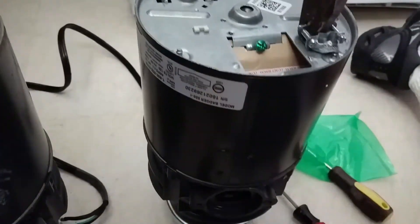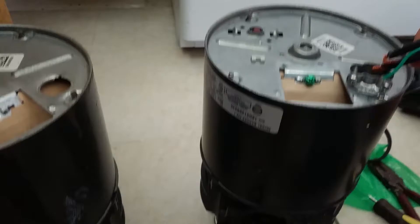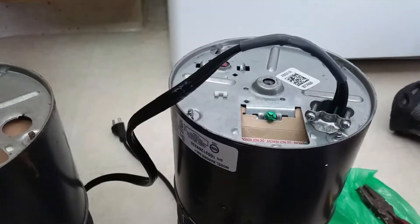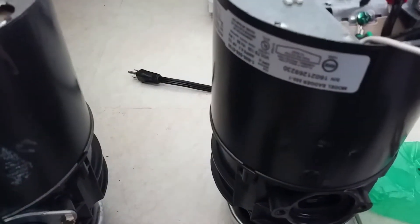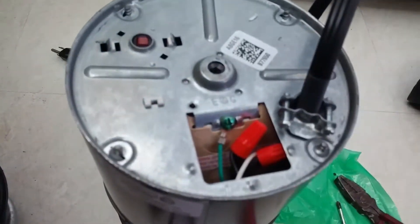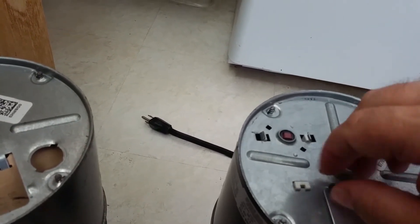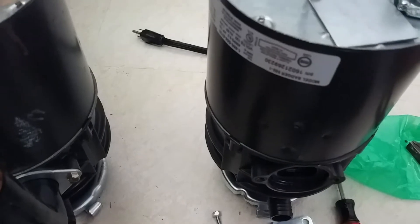Snug that up with a pair of pliers. Next, we're gonna install the cord — push it through here. It's easiest if you bend the wire a little bit and then fish it through like that. Here you can see the wire nuts are firmly in place. Make sure you have that ground wire snug, then go ahead and tuck those into the electrical bay. Go ahead and put your plate back on, making sure it falls within these little slots to keep it in place, and snug that up.